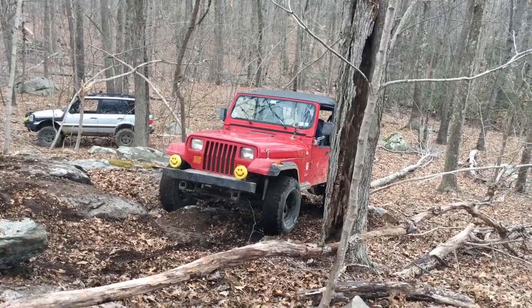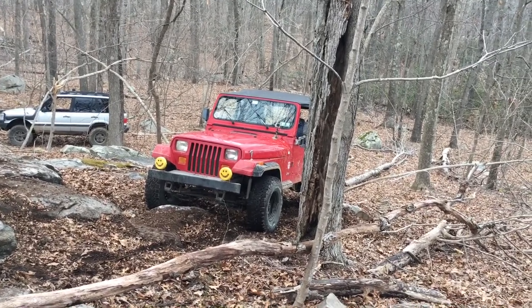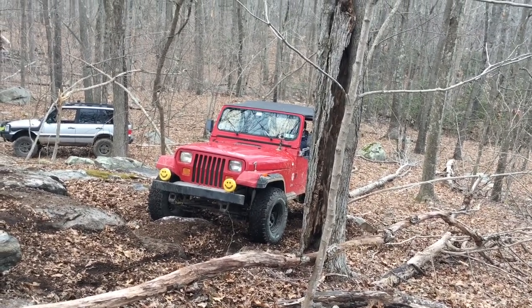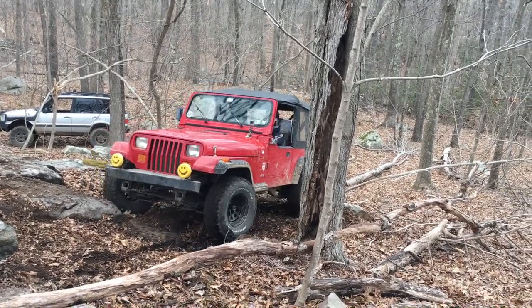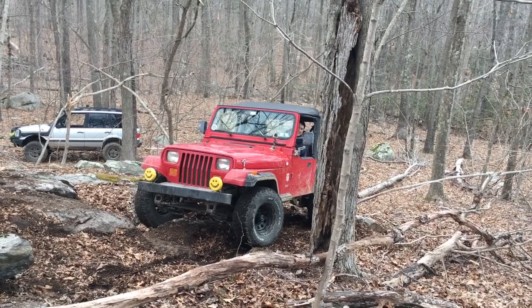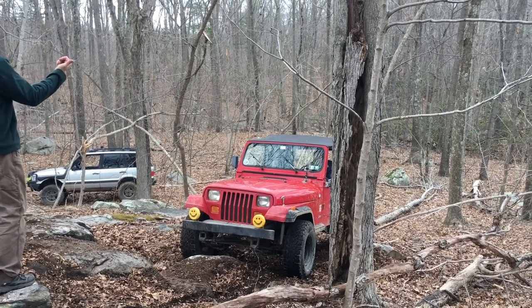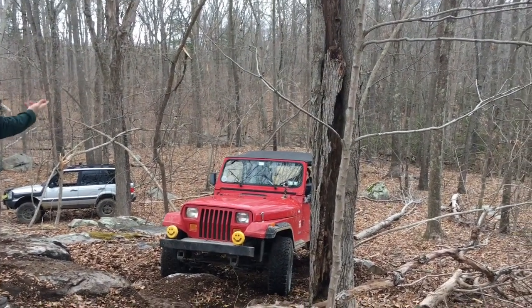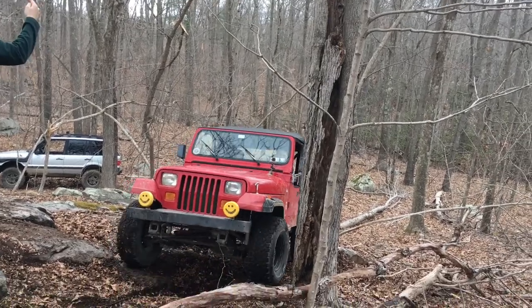No, that's the tie rod. Or the tie rod. I mean, yeah, it does. That's good. This way a little bit. It's scary how much that moves. I just can't see it moving in relation to the tie rod. Or the whole assembly. I think the whole assembly. Keep going back. Is one of them loose? What if the ball joint's not in this? What if it's loose? That's what I was thinking. If anything, it's the ball joint. Yeah, but I think we'll just replace that. I don't think it's seating in the socket.